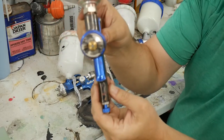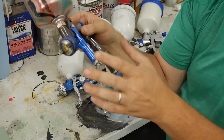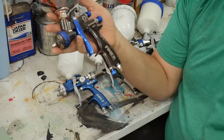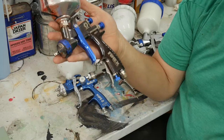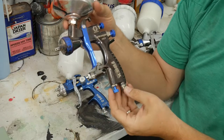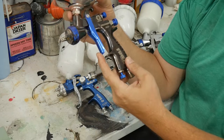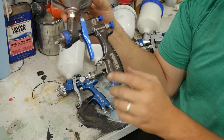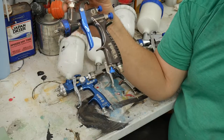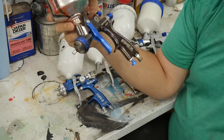It's all metal, heavy duty. It's got two extra holes that keep the pattern looking real good and it atomizes well. The only downside is the fan isn't the largest, but it is a very large fan for a gun this small and compact. The overlap is about 10 inches, which is totally workable if you're going to paint a car. Great gun.